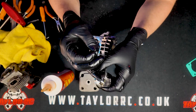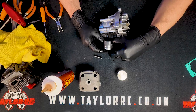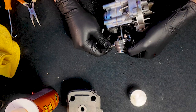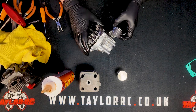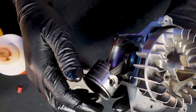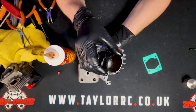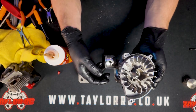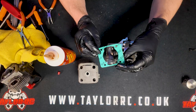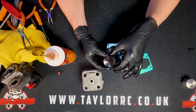The best way is to get the open-ended part started on the bottom, then slowly work and push around until you're able to push the other end into the opposite side. This takes time and patience so you don't damage the piston. You may lose one of these, so consider keeping a spare on hand — they are fairly inexpensive. With this side on, arrow facing the correct direction, install the piston over the washers and hold it in place while you take your piston pin — oil it as well — then gently align and push into place. With the piston on the pin, put in the other retaining clip. Double check that both snap rings are fully inside the retaining groove, and verify the exhaust orientation is correct on the piston. Install the cylinder base gasket and then the cylinder itself, making sure the alignment pin for the piston ring is correct.